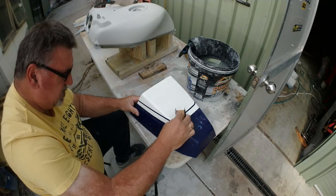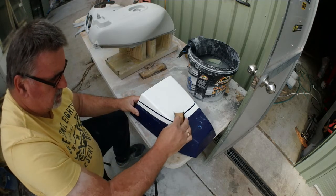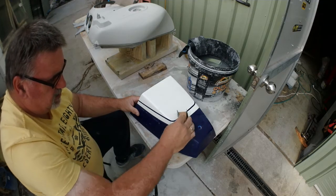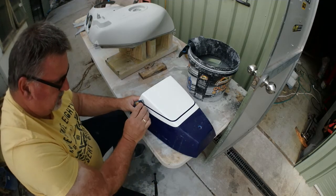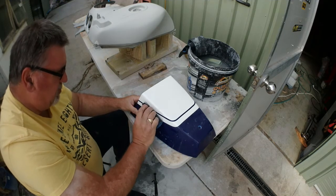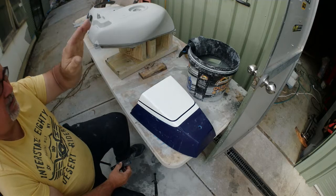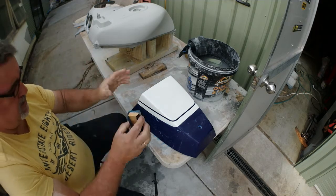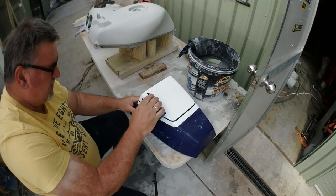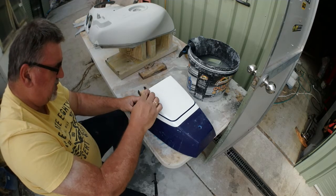It's always going to give a better job because you're flattening out, to a point, the last bit of paint you put on. It's always going to give you a nice and smoother job than if you don't do it and you just paint. Because I don't know if you know, but paint, when you look at it under a magnifying glass, can be quite pointy, which is what you feel as that roughness when you rub your hand across it. Those edge bits without cutting through anything.